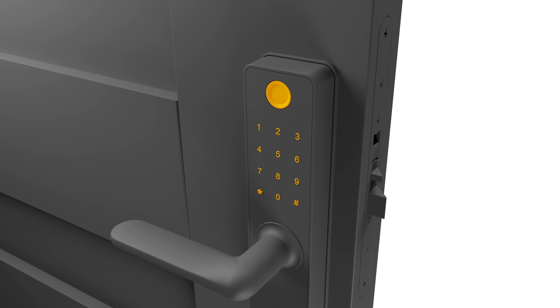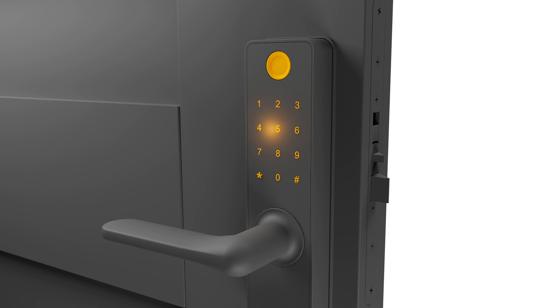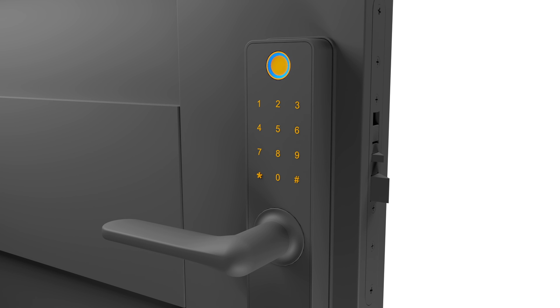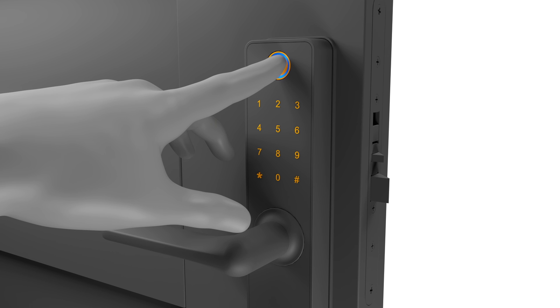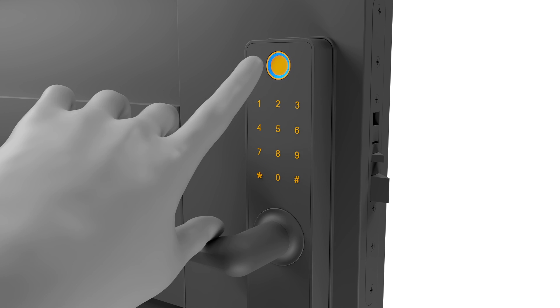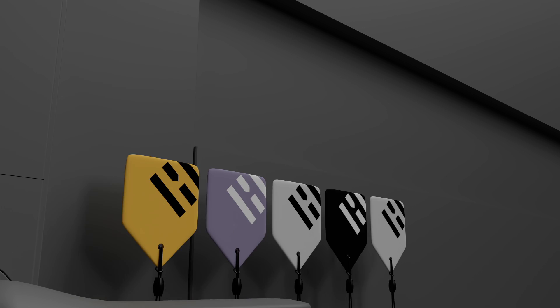To enable fingerprint access, you first need to scan your finger. Press and hold the function button for 3 seconds. Enter your master pin and star, then press 5 and star to access fingerprints. To add a fingerprint, press 1 and star. Select a memory slot number between 01 and 39 and press star to save your fingerprint. Please note, the selected memory slot number for your fingerprint will be overwritten if selected again. When the finger sensor LED is blue, scan your finger by pressing it firmly against the sensor surface. If the scan is successful, the LED will turn green with one beep. Lift your finger and repeat this process two more times using the same finger. When all three scans succeed, the LED will turn off, followed by a long beep.